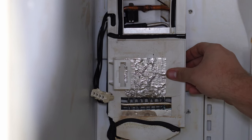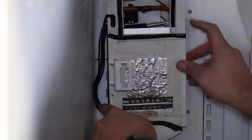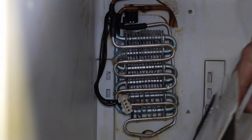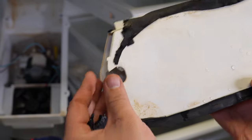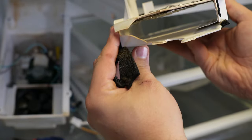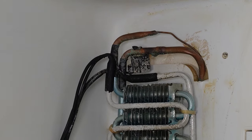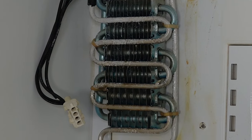Use a garment steamer, air dryer, or fan at the coolest setting to remove any massive ice buildup on the coils. In my case, there was just a light coat of frost and I was able to simply pull down to fully remove it. With the cover removed, you can see the actual problem: the cover is absolutely destroyed at the bottom, which causes a ton of moisture to get into the ice-making system, causing everything to freeze up and jam. The coils weren't able to defrost faster than the ice was building up.